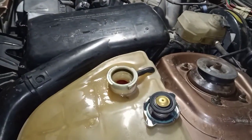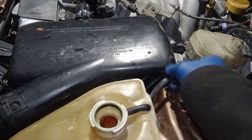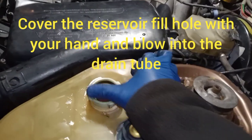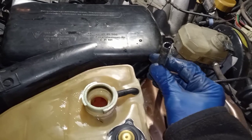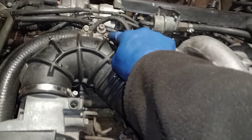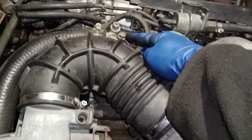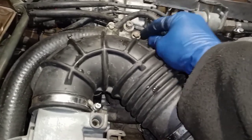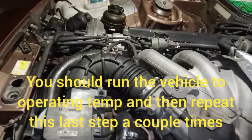Now here comes a trick that has saved me the most time. You're gonna take this overflow hose, which is just open on the other end, and you're going to cover this hole with the palm of your hand while you blow into this hose. You will be expelling the air out of the open or cracked bleeder bolt right there. You just keep doing that until you start to see coolant come out here — that means basically all the air is out of your system. Then just shut that off and you should be pretty much completely bled of air pockets.